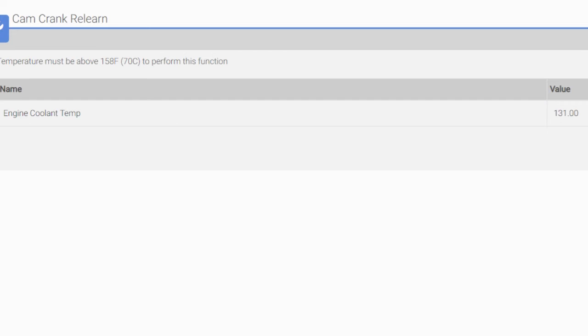All right, I just like to do things quickly because likely when the car leaves me, it's going to go into the hands of the customer. So if I do it myself quickly, I'm going to test drive the car, don't get me wrong, but I'm also going to do it quickly, electronically, using a scan tool. That's why on transmissions we do things like quick learn. That is just learning the clutch volume index quickly, hence the name quick learn. As opposed to rebuilding a transmission and giving it back to the customer and telling them, yes ma'am, drive it at least 50 miles, it should be back to normal.